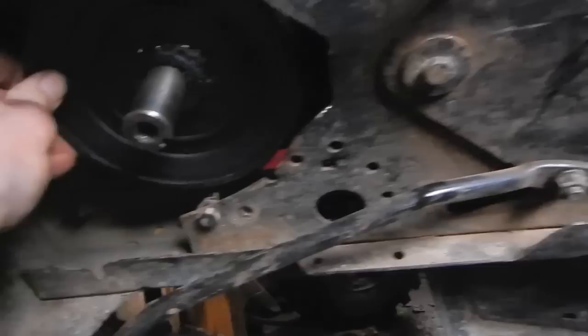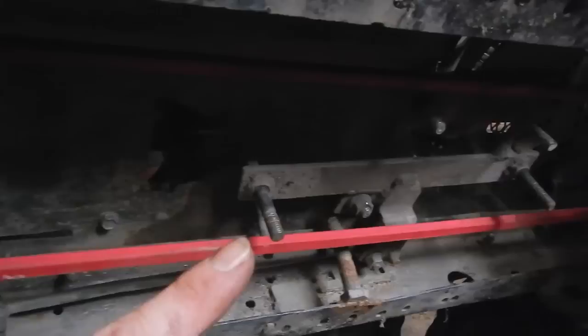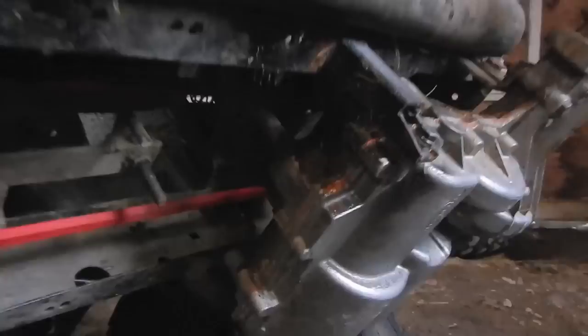Here's an update on the progress. I've got that pulley stuck into place — there's no keyway, nothing in there. You can see the red belt is now also in place and I am freaking out because this 92 inch belt is not long enough. That's not the only problem — there's an even bigger problem I just noticed. Now that I don't have all these other pulleys in the middle, I've got perfect alignment between my front and rear transmission pulley, and I noticed that the belt looks like it's feeding off the bottom of that pulley.